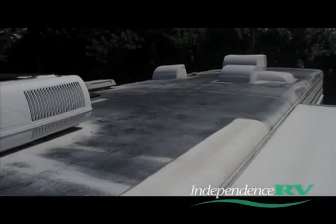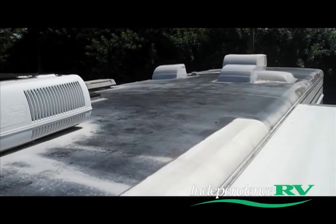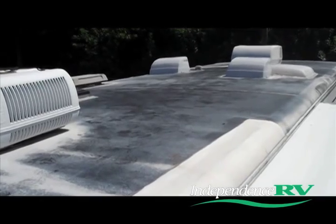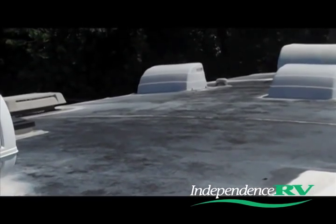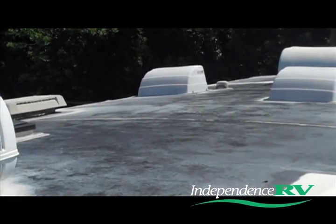Now the vehicle today that we're going to be examining is a 2000 Fleetwood Pace Arrow. So let's go take a look at the roof and see what we find. Dan, the roof we're looking at today is a rubber roof, also known as Dicor. This is the first generation of the rubber roof systems, and as you can see, this roof is kind of colored black. The reason for that is the top rubber layer, the white layer, is actually worn off this roof due to sun, weather, and deterioration.